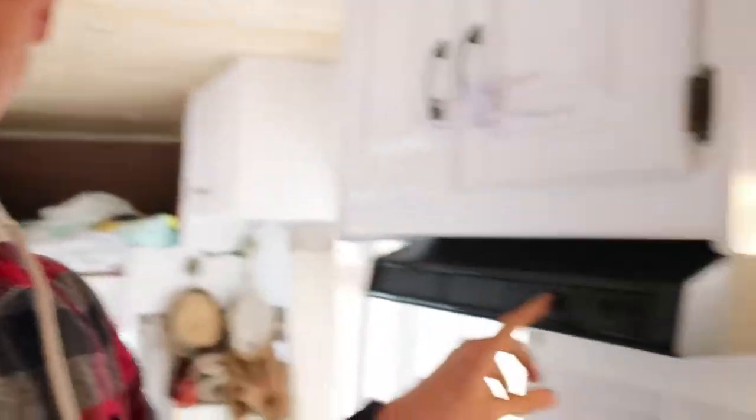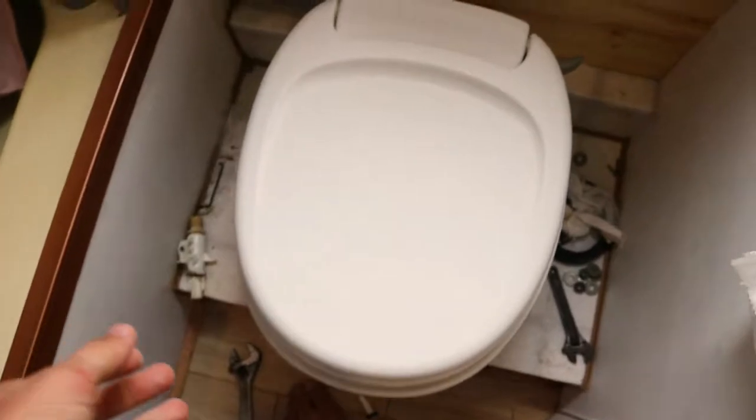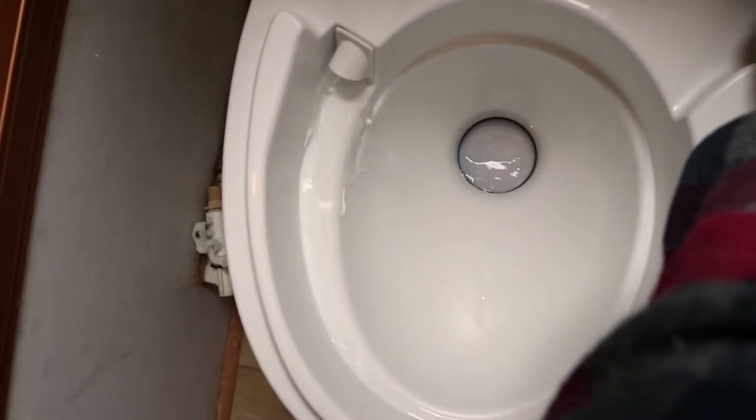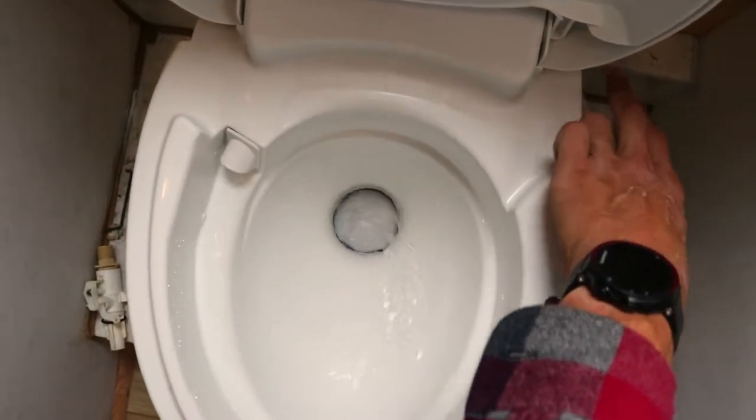That is in. Now it's the moment of truth — we're going to turn on our water pump and see if we can get some water to go through. It's stopped and I don't have water spurting everywhere, so that's a good sign. Let's check in behind — just check for any moisture down there to see if there's a leak in your taps or in your seals. Give it a little bit of a wriggle to see where the bumps on the road are going to do the same thing. That seems pretty solid. Now it's time to test — we're flushing. Water's coming through. We're a little low on water so that makes sense. Full pull — down it goes.